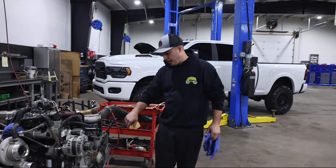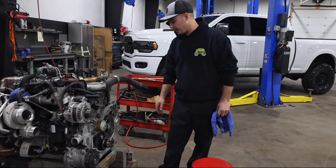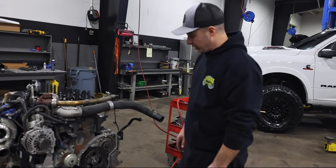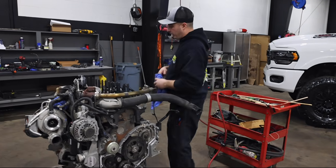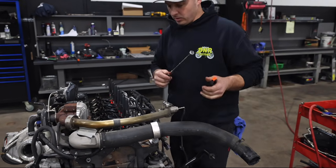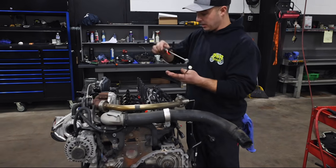All right, so the cam went in pretty smooth. We got our retainer all bolted back in and checked all the bolts in the front cover. We like to put a little dab of red Loctite on the retainer bolts just because we don't want them to come out. Everything felt good going in, so now's the time you just start trusting in the process: you pull your magnets out and let the tappets fall back up and rest on the cam.